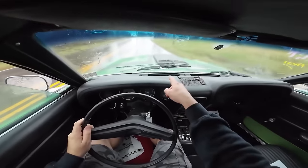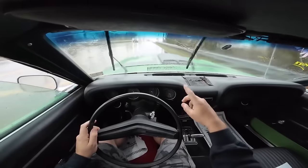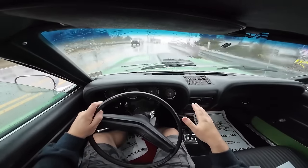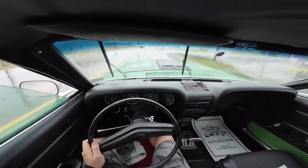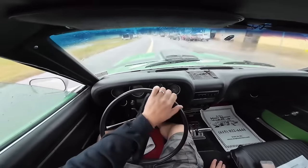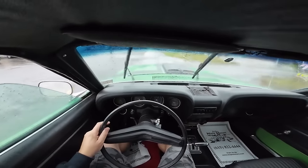I hear the fan sounds like it's tapping something up there too. But it could just be the belt. And I'm going to find out here at the end when we do the walk around. Typically you want to cut the car off, check the fan blades, make sure nothing's loose, and then cut the car on, check the belt, see if it's loose, and that's what we'll be doing. If you mess with a fan when the car's on, it could be dangerous. But I'm going to say that's going to be a belt and a pulley squeaking.